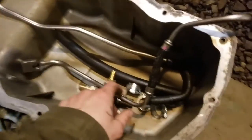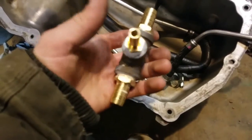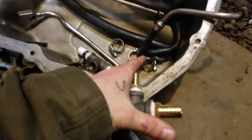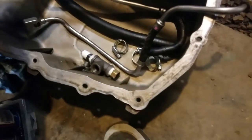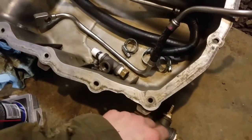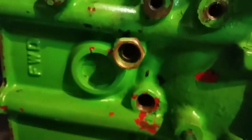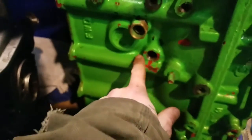I think we're going to start this tomorrow maybe. I got hose clamps and everything ready. So here's going into the heater core line — this feed line right here will connect into that one, as the factory does on the SRT4. Goes off the heater core line, goes straight into the top of the turbo. And then we have this feed line that will go to the top of the turbo as the oil feed. On the factory SRT4 it goes right here — same thing on this one. It has the same fitting hole, so we're going to use the same kind of fitting.